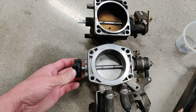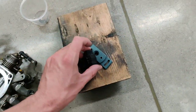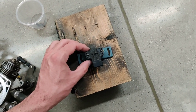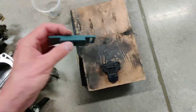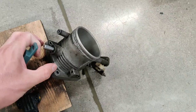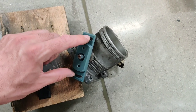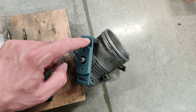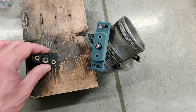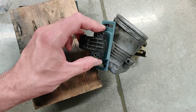This adapter sets on like this — you put some screws through and some bolts and it spaces out to fit an older style throttle body. There's a little adjustment back and forth on these screws just so you can get it somewhat centered in the range of motion, because these don't continually spin all the way around — they go back and forth a certain amount. Then this sensor just slides on and you can screw it on.